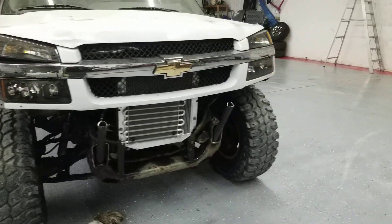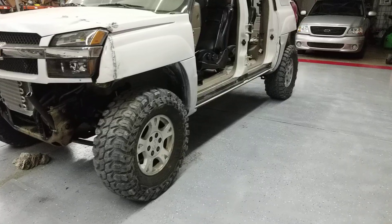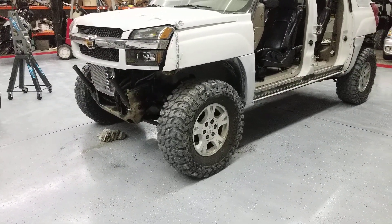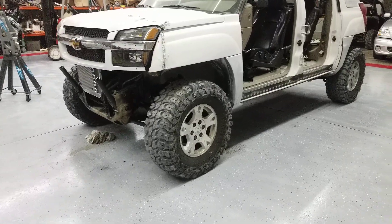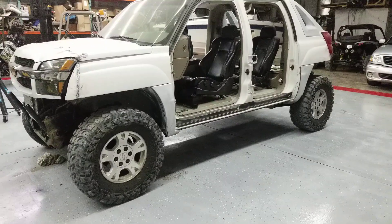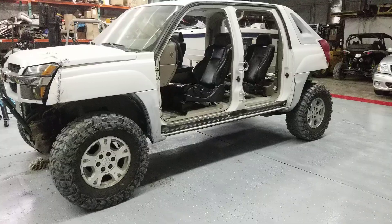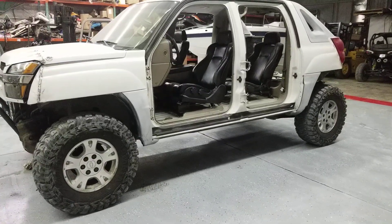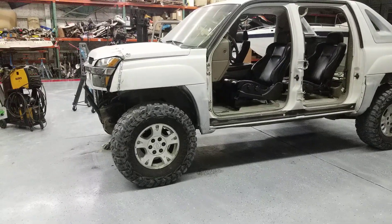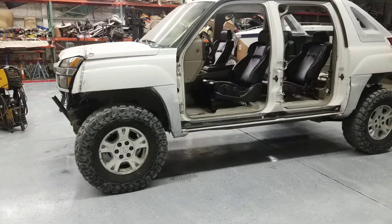I've got a welded rear end. I wish I could get into the front diff — someday if it ever becomes a straight axle truck, you'd definitely want a limited slip or a good locker up there, and it would make it a lot better. The only part where it struggles is getting into something where it's just got one wheel up front going and the one hanging in the air is usually the one spinning doing nothing. I might put a little line lock on it to be able to lock out one tire or the other in the front and get the other one to bite.